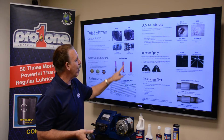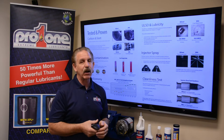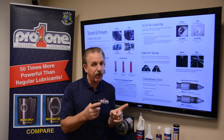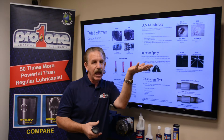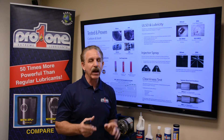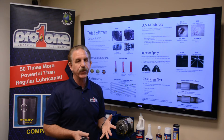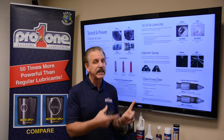Here's what we do: we push water to the top. 58% of the water is removed just by being left alone in a six-hour period — that's in the test tube in the lab. 42% of it is emulsified. So 58% of the water is removed because we push it to the top and it evaporates out. On your vented tank going through a charcoal filter, we remove water by pushing it to the top — water pushed to the top is no longer on the bottom going to your injector pump. This deals with 100% of your water problems: 58% evaporated, 42% emulsified. You've never found a product dealing with a hundred percent of your water problems in diesel fuel.